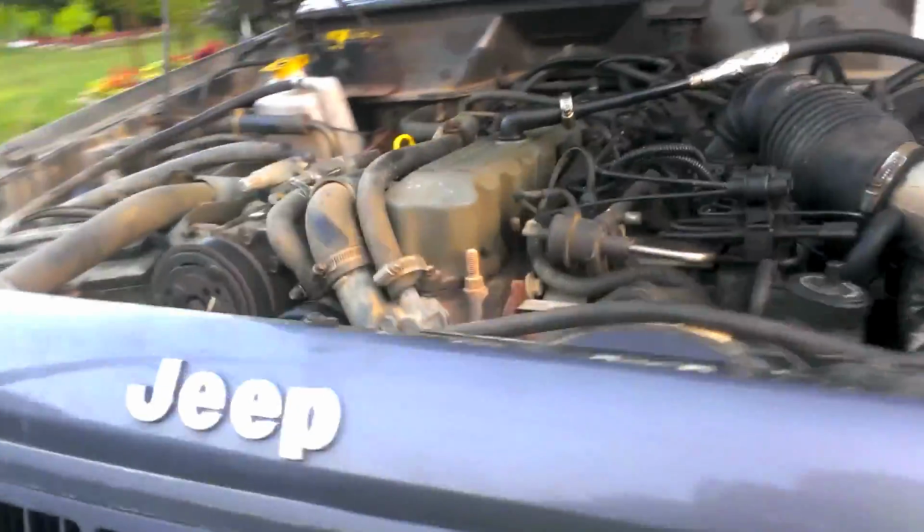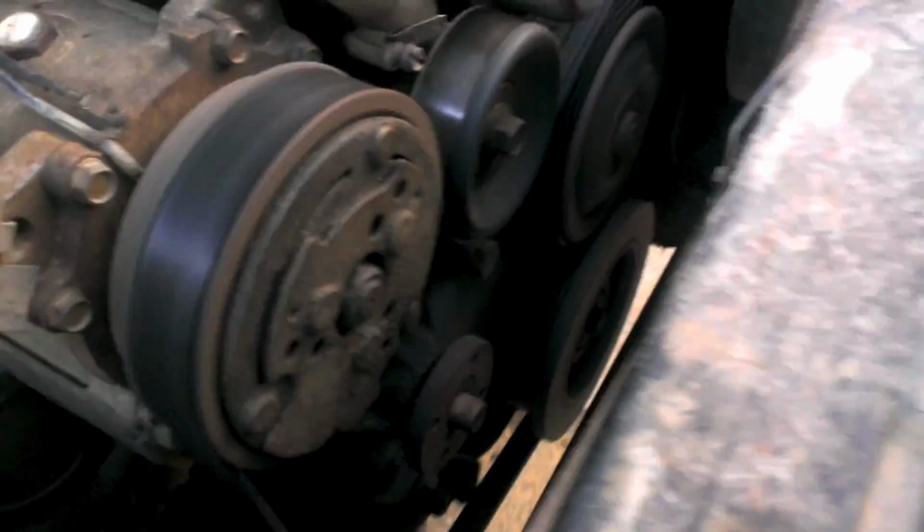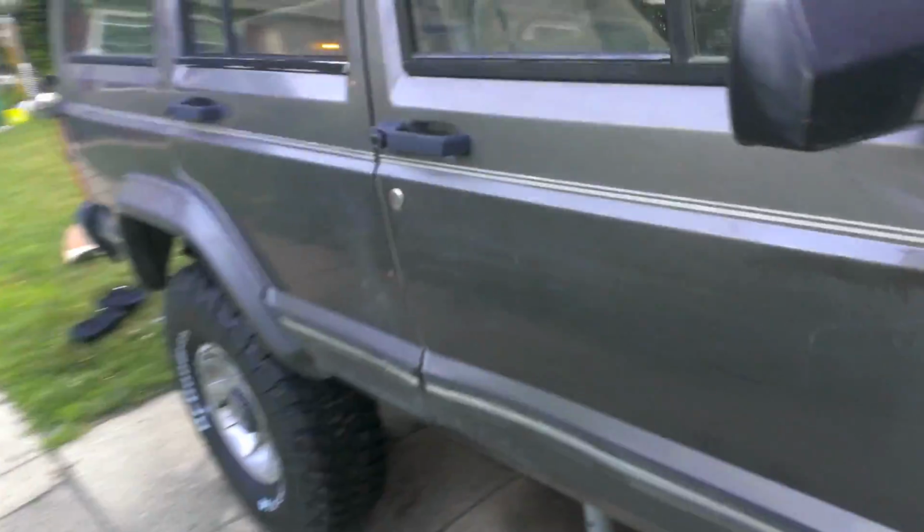So I'm gonna put my gas back in the tank and see if I get a leak. It's alive! It's alive! Excellent. That's what I'm talking about. Starts sounding a little rough. It didn't like starting at first. But a couple whacks to the starter got that thing dislodged, and once the fuel pump got all the air out, it's running.